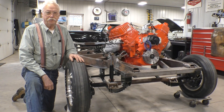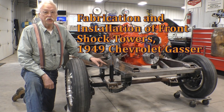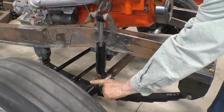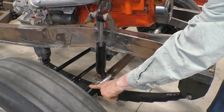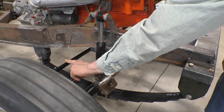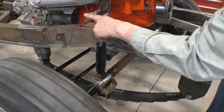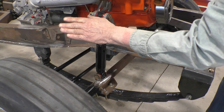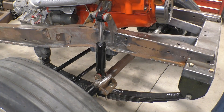Hello YouTube. This video is about this shock and why we're doing this project over again. This shock would be fine if this axle just moved straight up and down. However, in past videos we've learned that this axle also moves to the rear as you bounce it up and down. Now this joint right here can handle moving like this, but it can't handle moving like this, so we have to redesign it.